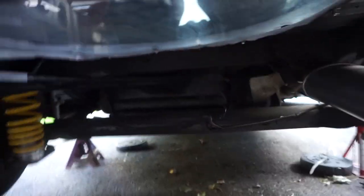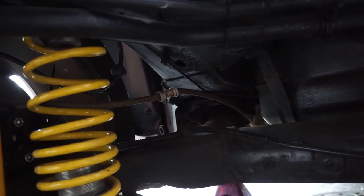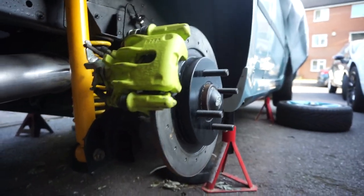If you look underneath the car you can see the brakes are all on - I still need to put the wheel on that side. Coming down a bit lower you can see I've run the handbrake cable all the way through the top and I need to get it pinned down properly. One thing I didn't think about is that the Ford Focus is a much longer car, so those cables are obviously going to be longer - that literally didn't cross my mind. I've got a bit of excess wire so I just need to strap it down with cable ties, which should be fine.